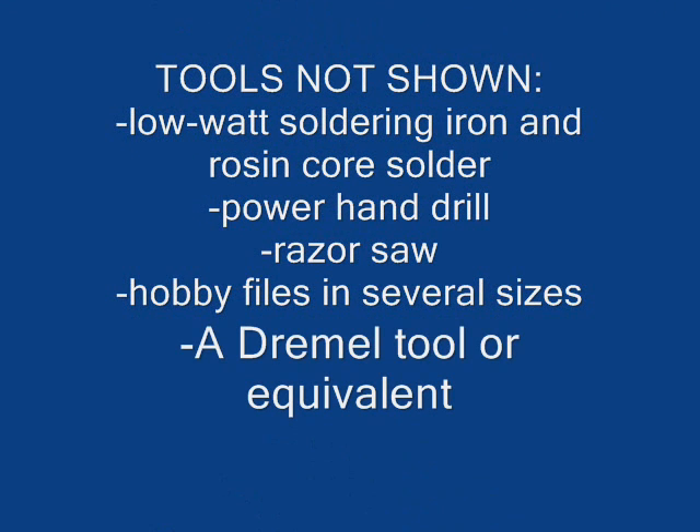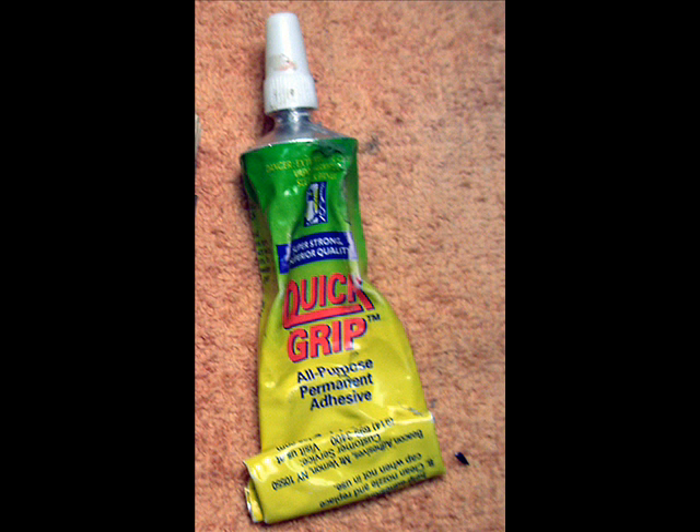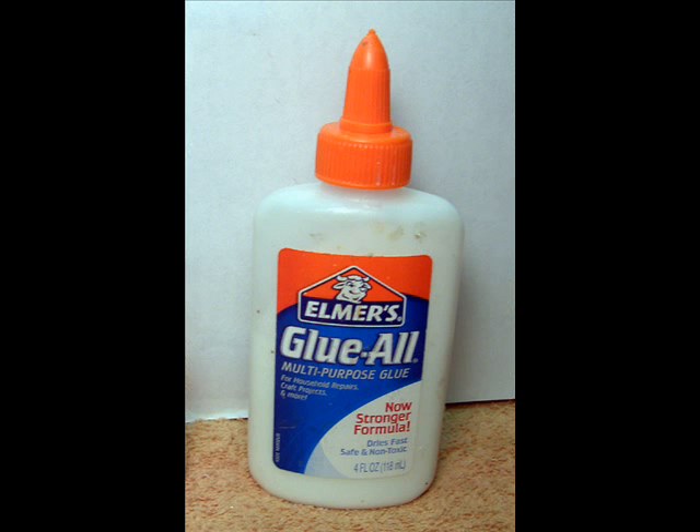What I haven't shown here is a soldering iron — I use a 40-watt model, as well as solder. I've tried to use a drill press to make holes, but I have a lot more control with a handheld drill. The glues I use are Crazy Glue or Super Glue. There are a lot of different brands and types — choose one that's thicker than the standard variety, as it's easier to work with. Quick-grip glue is especially helpful in attaching the LEDs, but also good as a general glue when two odd materials need to be solidly joined. And good old Elmer's white glue — that's used to reattach clear plastic like headlight lenses because it doesn't craze the plastic, and it also dries clear. Sometimes you can use a fabricated lens in head and tail light openings.